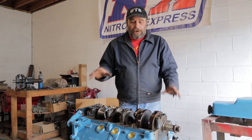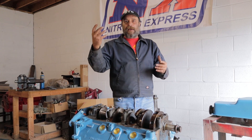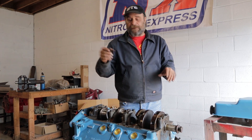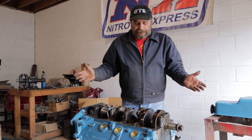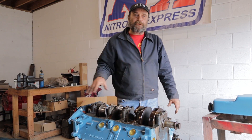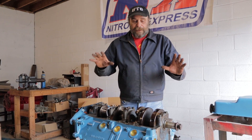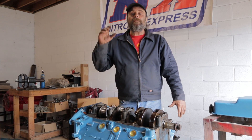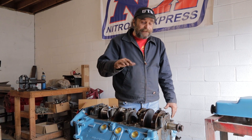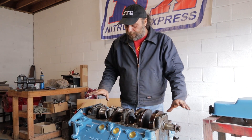That's what production balancing is all about. If you're taking a piston out of one 302 Ford and popping it into another 302 Ford, the balance is going to be the same, providing it's the same configuration. In our case, since we're not changing the pistons or the rods — it's the original crank that went back in — this thing is production-tolerance balanced to spin to 5,500 to 6,000 RPM. We will not spin this thing that high. The top end of this engine is probably around 5,200–5,300 RPM. So all the balancing is fine.